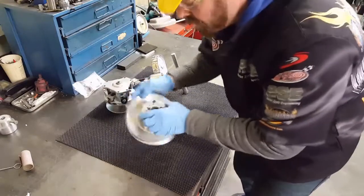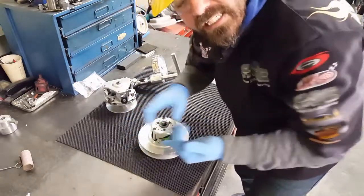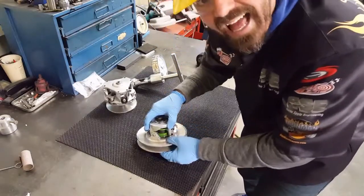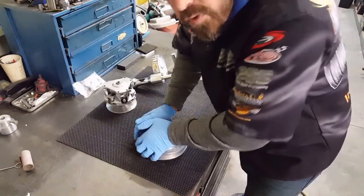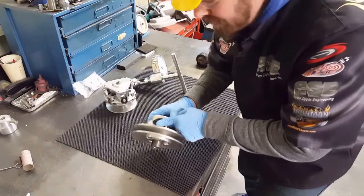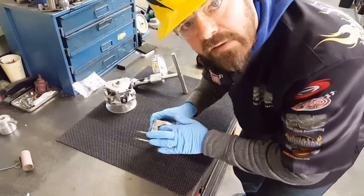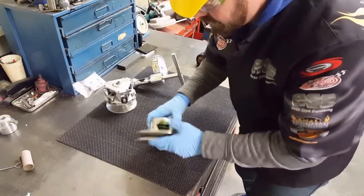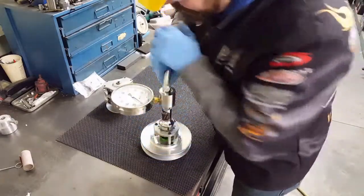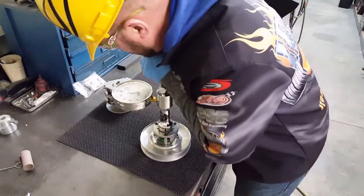That's not accurate. What is accurate is when you have a torsion spring that's being pushed down to get spring tension, and you're also hitting your rollers or your slides on the ramp, which gives you, when this clutch is coming in, it's got that friction right there. So depending on how clean, depending on so many factors, lubricity, I don't think that came out right, but I think y'all know what I'm talking about. All has to do with it. Now you can further push this down until it stops and check what your open rate is.